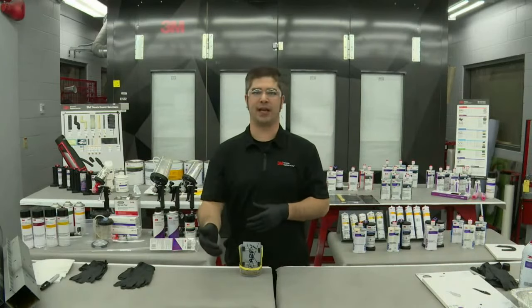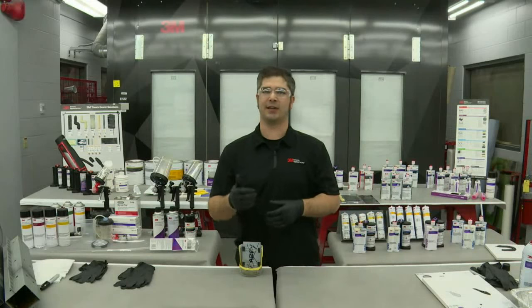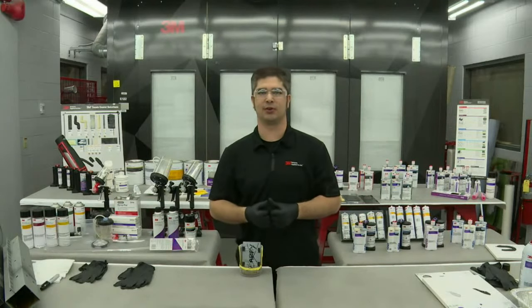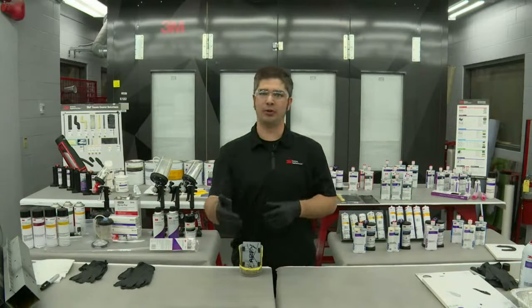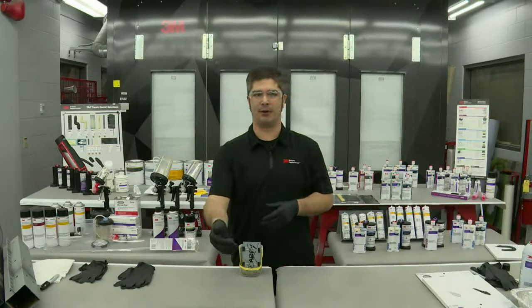The way we can replicate that in the aftermarket, restoring that original e-coat protection, as I mentioned in that Crib 186 Toyota bulletin, per their bulletin, the only way to restore that factory e-coat protection is a 2K epoxy primer.